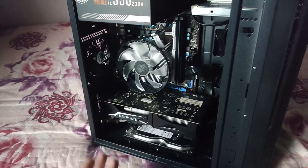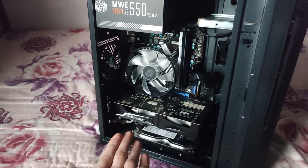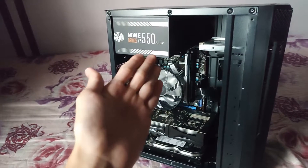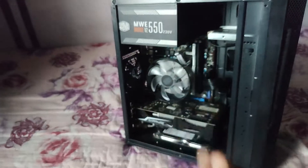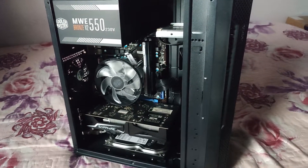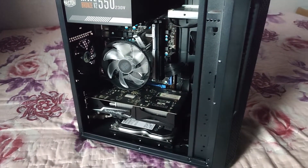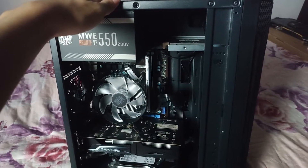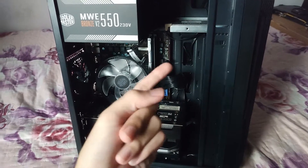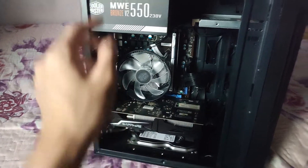As I was trying to reconfigure stuff, I was not able to enter the BIOS setup. And want to know why? It's because of Windows. Shutting down Windows 8 onwards does not do a full shutdown — it's called hibernating. Hibernating does not allow you to enter the BIOS. I could not enter setup until I booted into Windows on my SSD, which I'm glad it did boot fine. My final fix was to disable hybrid boot in Control Panel, and after one restart I was able to enter the BIOS. Everything works again.